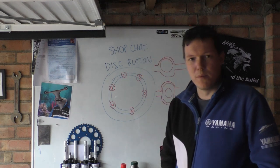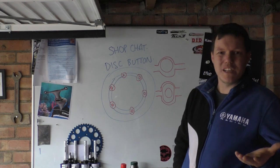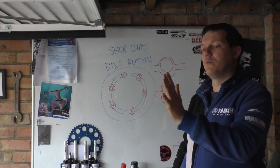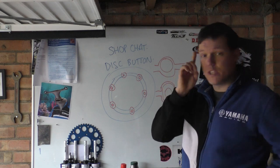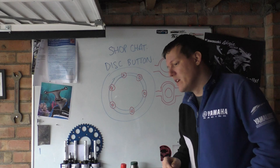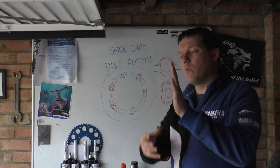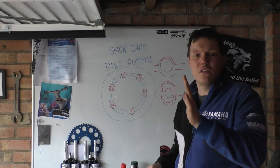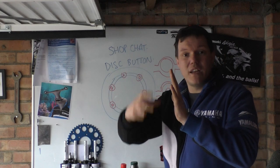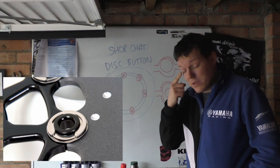There are two types of buttons. There are riveted buttons — this is done at the factory, and it's just like any kind of rivet: you force through one side and squash it, similar to chain rivets. Then there's the other type where you have wave washers just to distribute the load, and then there's an actual e-clip. I'll show some pictures. The e-clip versions mean you can replace your rotor without having to mess around with your hub.